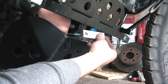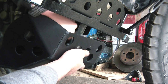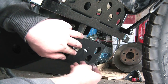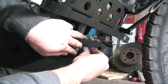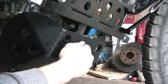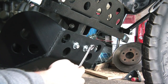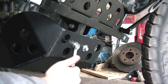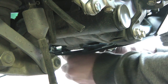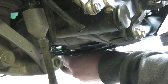There's a u-bolt that holds the skid plate on — it goes around the same bar that we attach the radiator guard to. There's also a little aluminium block that goes on as well, which sits behind the skid plate. Slide it through the two holes in the front of the skid plate. Once the u-bolt is through, put the washers and nylock nuts on — being nylock you don't need any thread locker as they will self-lock. Tighten them up equally, but not too much yet, as you need to align the plate and make sure everything is nice and straight. Once the u-bolt is secure, tighten up the brackets on the underside of the skid plate using the T40 torx bit again.